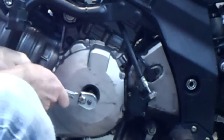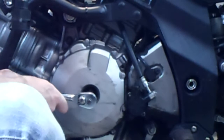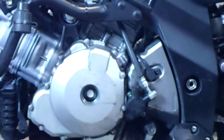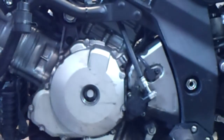I got one plug in now, so I buttoned up that back cylinder. Let me see. I got my FT lined up again. Okay, so I'm back in the A position on these cams. Time to get my feeler gauges out.